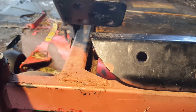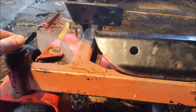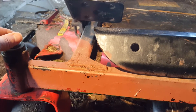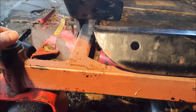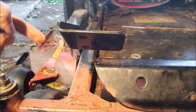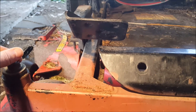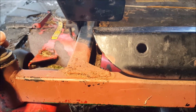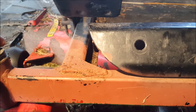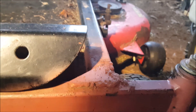So if you have a mower like this, you may want to take off this little front decorative plate that says Gravely right here and check this before it comes off all the way, because it would be much easier to fix before it breaks off completely. You can catch it while it's still on. I think I used ratchet straps last time, just ratcheted this so it would stay back against the member and was able to weld it back on. You might want to check that out now while it's cold in the northern hemisphere and the grass doesn't really need to be cut. It's one of those things you can check on and take care of in the off season for your mower.